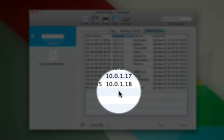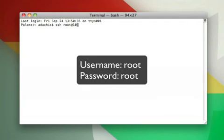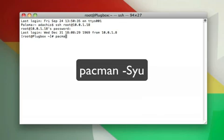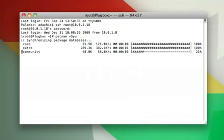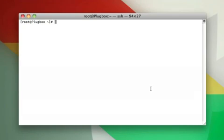You're going to be disconnected, and we'll see if it works. When your PogoPlug reboots, it may be under the same IP address or it may be under a new one. It's worth noting that your root password is now just 'root' — not what you set in MyPogoPlug.com. So when you log in, use username root and password root. First things first, let's update our packages by typing pacman space minus capital S Y U. You might have to run this a couple of times just to get all your packages up to date because pacman itself might be out of date.